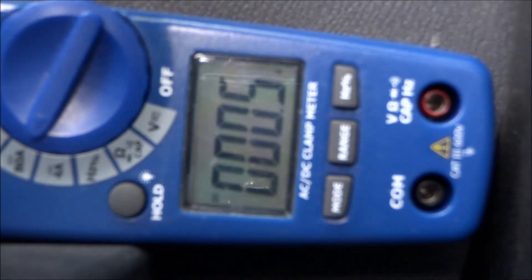I'm about 15 kilometers away from my cottage. It's unfortunate but this meter shuts off after a couple of minutes so I couldn't film during the whole trip. There's a hill coming up and it's about 12% grade, so I'll film the current draw going up that hill — that should give me a good maximum amp draw. As you can see right now I'm still drawing about half an amp from the prototype pack. Let's go up the hill and see how it does.